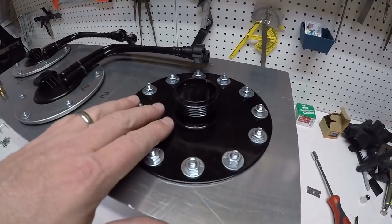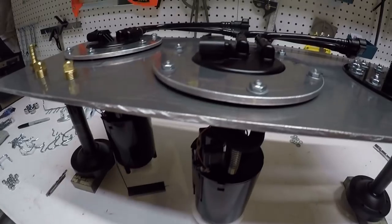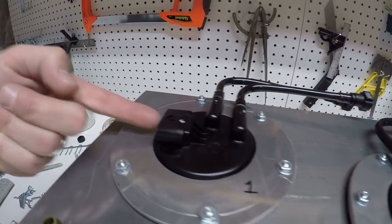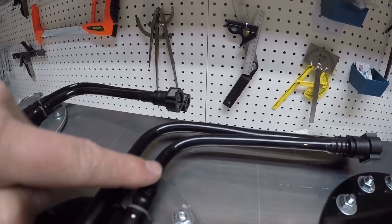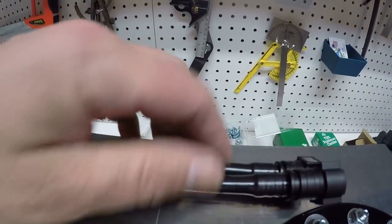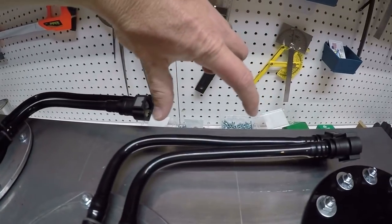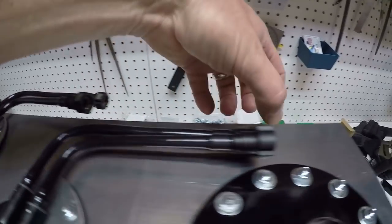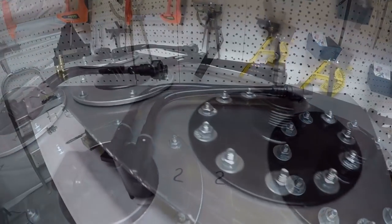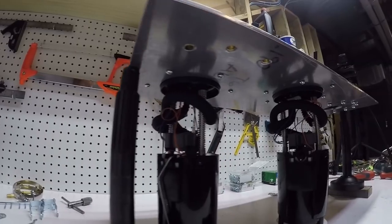So without any problems, here's the fuel filler, fuel pump number two, fuel pump number one, my vent, and the two plugs. These are the rings that sandwich the little flange on the factory fuel pumps. There's clearance for the plugs over here. I shortened the factory lines that come on the pumps and reattached the vinyl tubing onto the factory connectors. In the next video I'll be making some little mounting clamps for the fuel filters, which mount right here. The two fuel filters will then come together to a block, and from that block it'll go to the fuel rail on the engine.